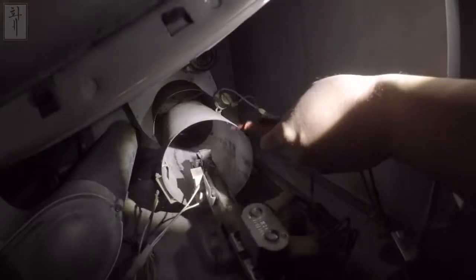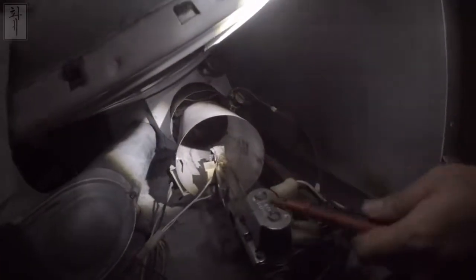This one right here — the thermal sensor on top right here. The reason the flame: once it turned on, the flame touches that. And I tested it — it was working. And then it was just triggering it. That means this got triggered — it means it's having resistance. So that's why it turns off, and makes the gas valve close. So there's no gas, and that makes the flame go out.